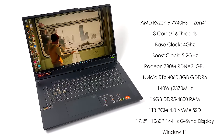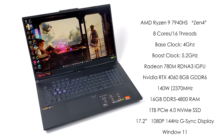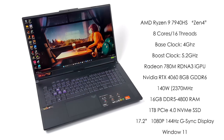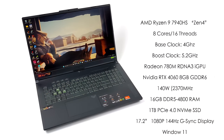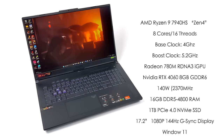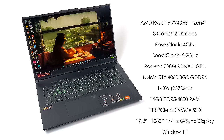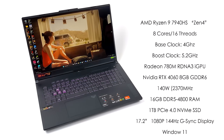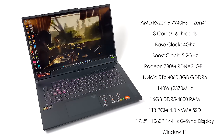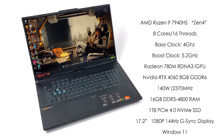For the CPU we've got the AMD Ryzen 9 7940HS based on Zen 4 — 8 cores, 16 threads, a base clock of 4GHz and a boost up to 5.2GHz. Even though this isn't AMD's flagship Ryzen 7000 series mobile chip, it is their flagship mobile APU and offers desktop-class performance. Since the 7940HS is an APU, we also have Radeon 780M graphics based on RDNA 3 boosting up to 2800MHz for indie gaming and battery savings. For AAA gaming we have the NVIDIA RTX 4060 with 8GB of GDDR6 VRAM doing up to 140W — a full-power 4060 laptop variant with a boost up to 2370MHz.